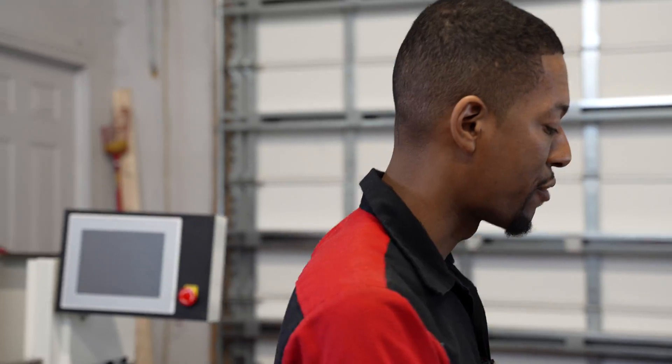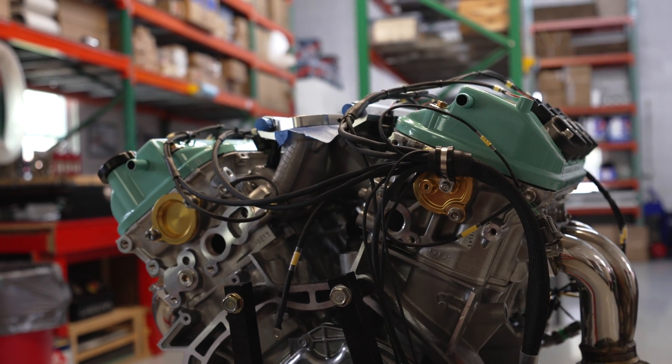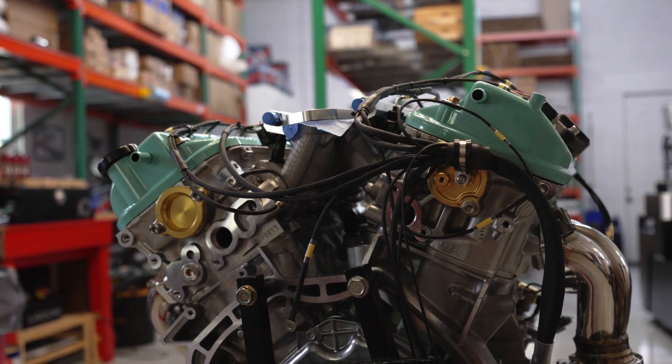We do have the Gates racing blue belt in here — it's a harder belt than the original one and we've had a lot of good success with that. On here we have a PJ Customs aircraft-grade wire harness. This harness is very clean; it was specifically built for this. We have a couple of flying leads out to the side that we're going to be tapping in for fuel, ECU, ignition power, and that will start this engine right up.